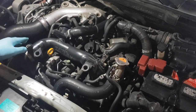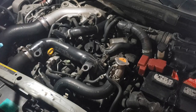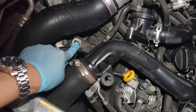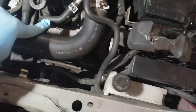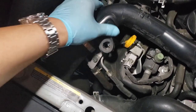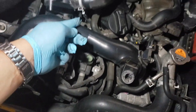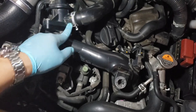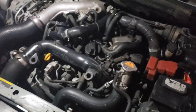What I'm gonna do is remove and loosen it up. Let me give you a closer look — there is a 7 millimeter bolt right here which you'll have to remove, and also another 7 millimeter bolt right here which you'll loosen up. You also have to loosen this up to take this tubing out, and the last one you have to unclamp and remove this tube. After that you can easily pull it out and clean the throttle body.